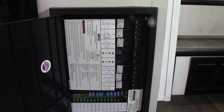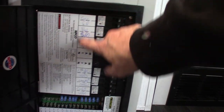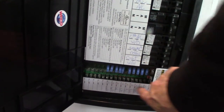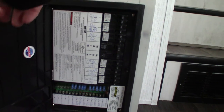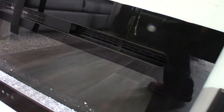This is the power converter — it does the opposite of the inverter. It takes AC power and converts it to DC power. You've got circuit breakers on the AC side, just like at home, all labeled. The power is converted to 12-volt DC, and there are labeled 12-volt fuses on that side. It also acts as a battery tender — it senses how much energy your battery needs and keeps it charged as long as you're plugged in. So the alternator charges the battery while towing, and this converter charges it when you're plugged in.